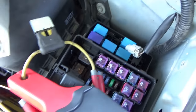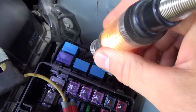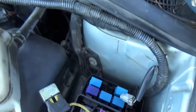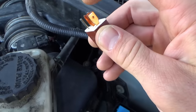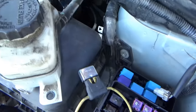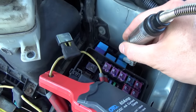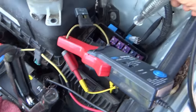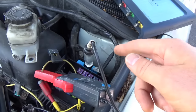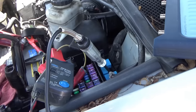What are we missing? So initially, I thought at this fuel pump speed control relay from battery positive, I thought that was shorted to ground. Well, that's a variable because I don't know which pin is which on the relay. That's kind of important. Apparently this one must go to the fuel pump. And we can check that. We can supply power to here, right? Plug the fuel pump in, and if there's continuity through the pump, then the test light should light up, right?